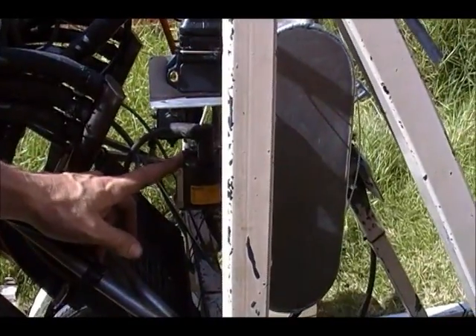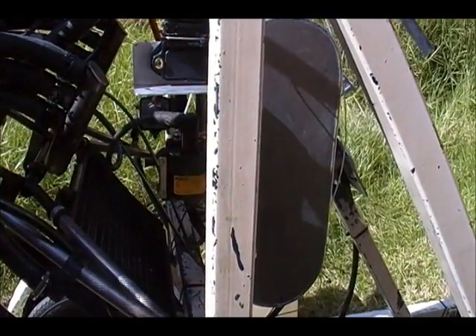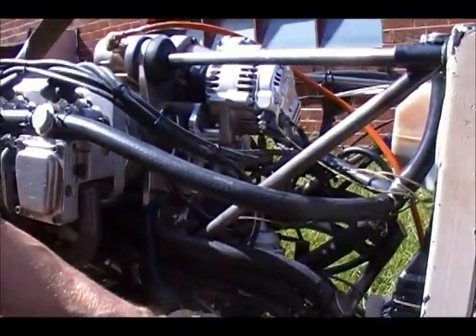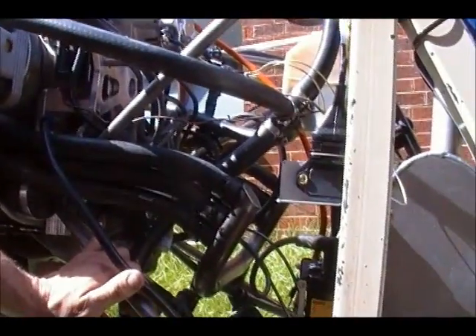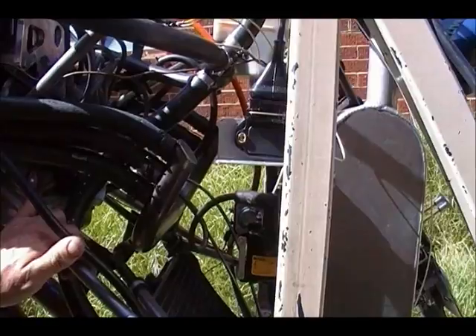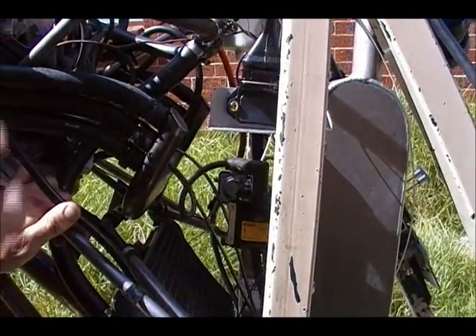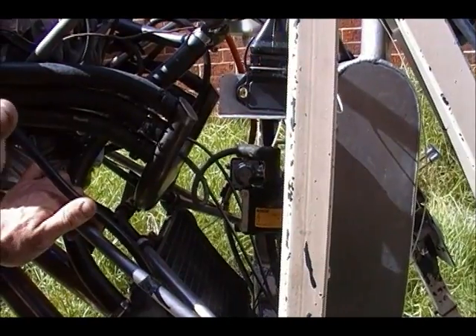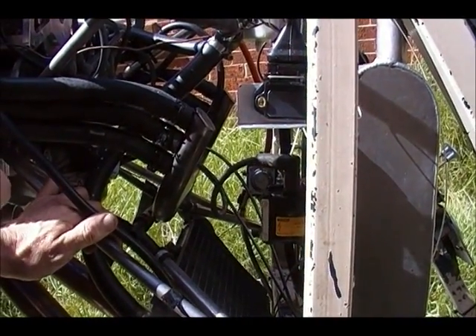What we've got here is the Rotec ignition system on the left-hand side, and we're retaining the standard Jabiru magneto on the right-hand side. In my opinion — and that's how we've run our radials for years — that's a fantastic combination. You've got two completely independent systems for redundancy, and you've got fantastic spark at cranking so the engine starts instantly every time, no matter the temperature.